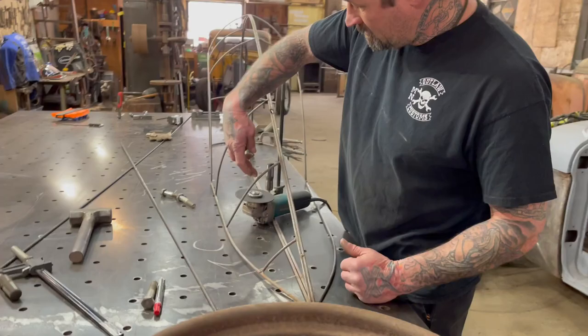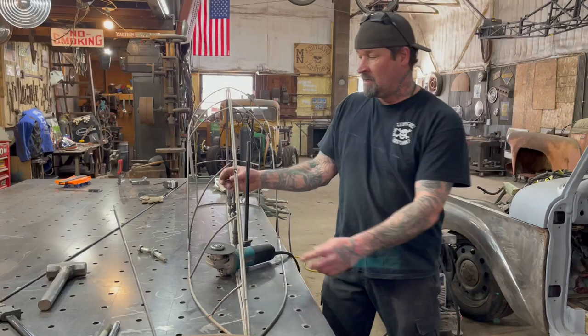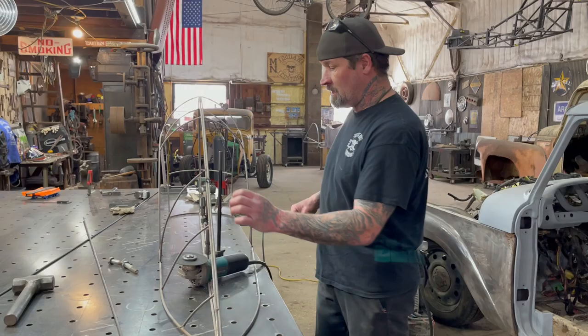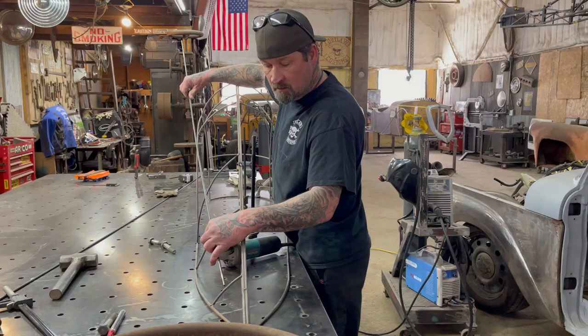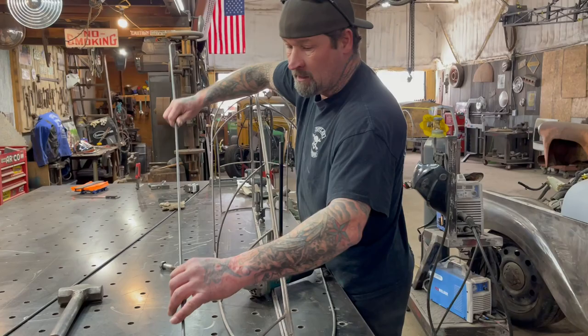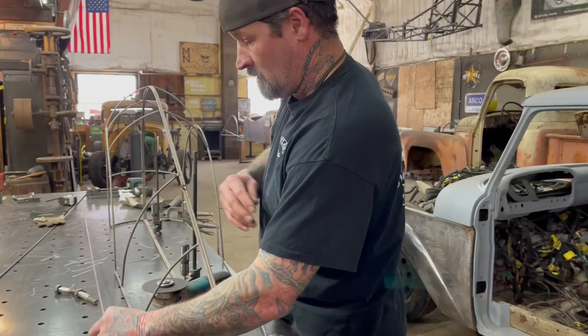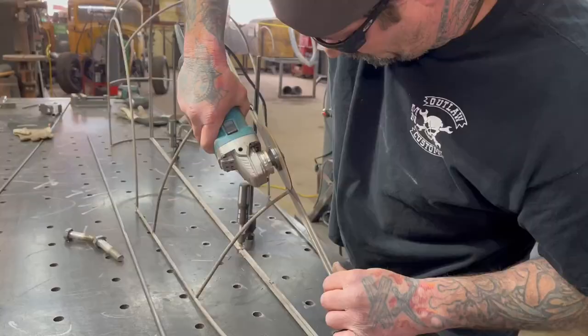The pieces are right here — I'm going to cut these out. I was talking to Heidi and I think we're going to leave this short one in here so that I have something to weld to. This piece here and this piece here I'm going to pull out. I have these just spot welded in so they're really easy to just cut the spot welds and drop them out. This piece here is what we're putting in today — it's going to be bent like this. I'm going to get the piece bent using quarter inch hot rolled steel, round rod, solid. This is the wire form buck for the fender — I'll go ahead and get these pieces cut out so we can start shaping.